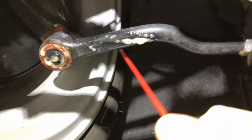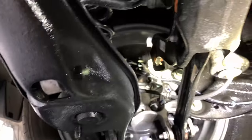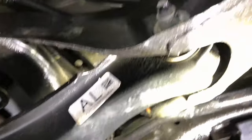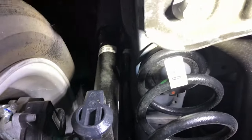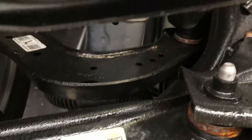Before lowering the car, I'm also going to winterize it — this is a daily driver. I'm going to use Fluid Film and just spray the raw steel areas to prevent rusting. I have a more in-depth video on my Evo. The areas you want to target the most are anything that you can't easily replace, like the frame rails, but also the suspension, struts, sway bars, end links, tie rod ends — pretty much anything that's not aluminum. Do not spray the exhaust; if you do, it's going to burn off and it's going to smell really bad.